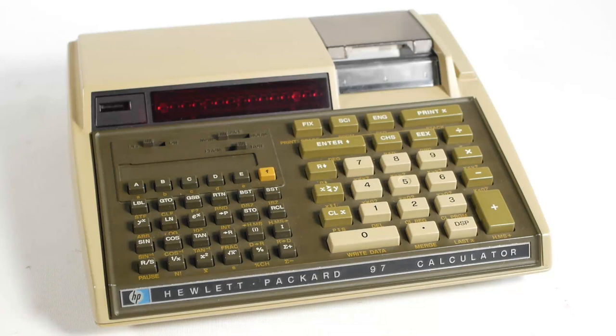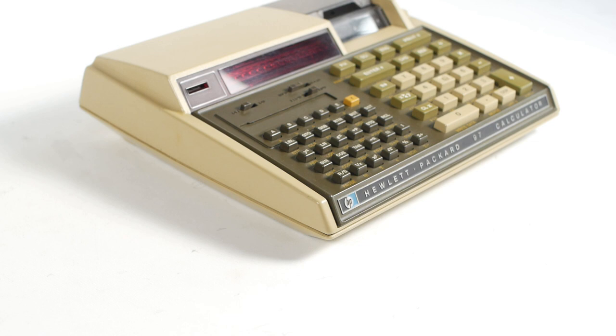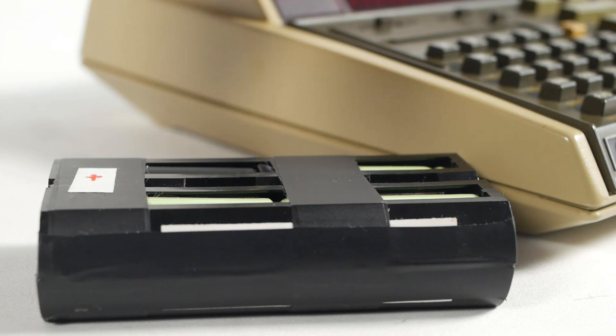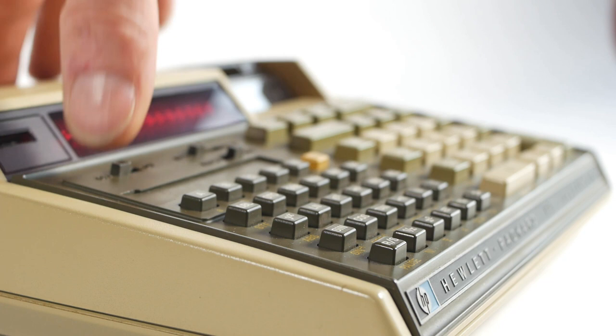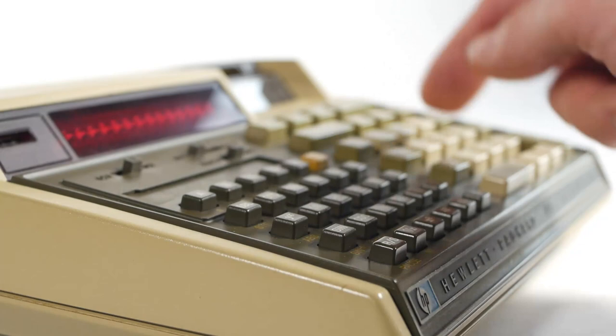We'll start off with what has to be the most phenomenal calculator I've ever used, a 1979 HP97 with its brilliant RPN method of working. I'd done my homework on these machines and I knew that the general recommendation is to never use the calculator just on the power supply or charger — you should always have a battery in place. So job number one was to dismantle the battery case and replace the four sub-C NiCAD cells. All pretty straightforward stuff. After that I plugged the battery in and tentatively turned the calculator on. It worked — blooming fantastic.